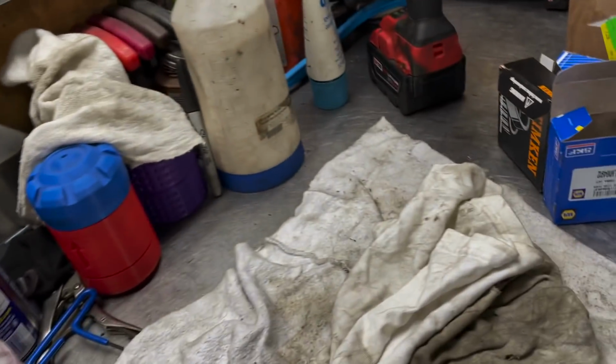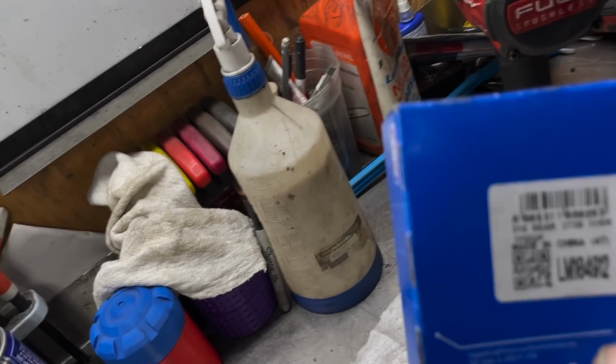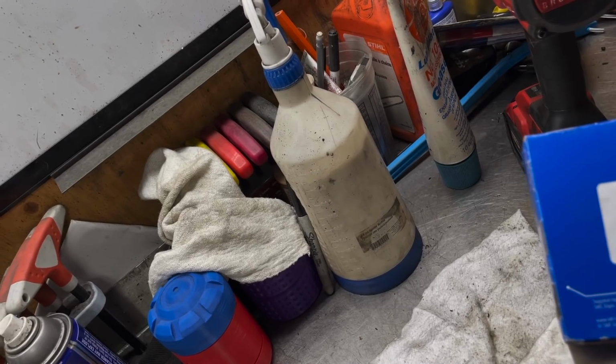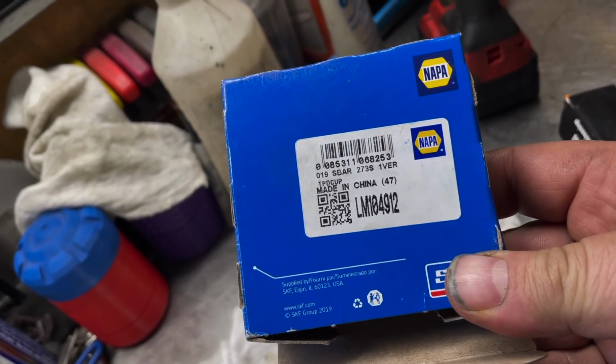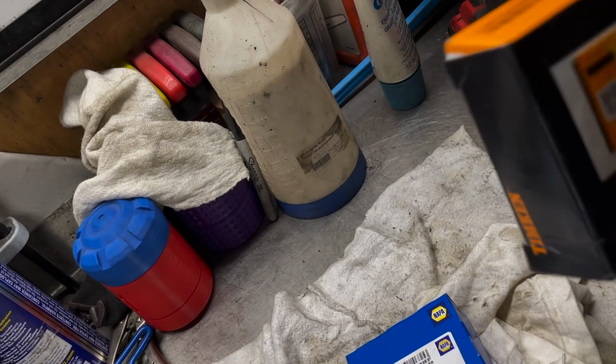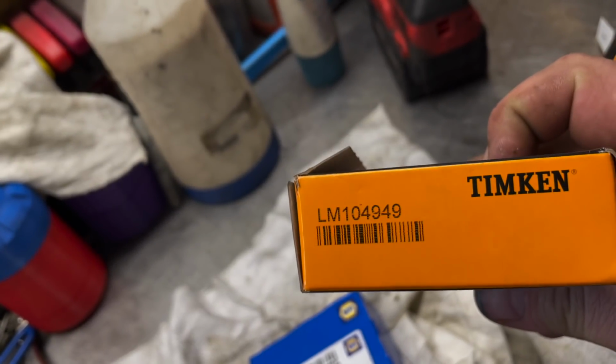Here's the broken pinion. If you ever have an ARB Airlocker, an RD117 or 117, whatever the heck it is, these are your bearing races, part number. That is your replacement bearing number. Well, it's messed up here because the ARB uses different bearings than what your rebuild kit will have. Unfortunately, it is what it is. It's lucky I caught that.